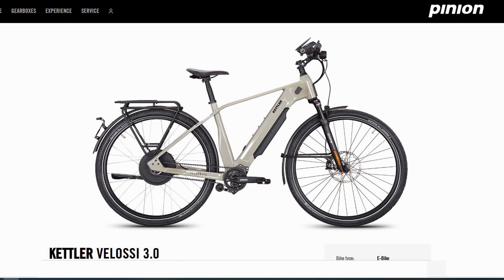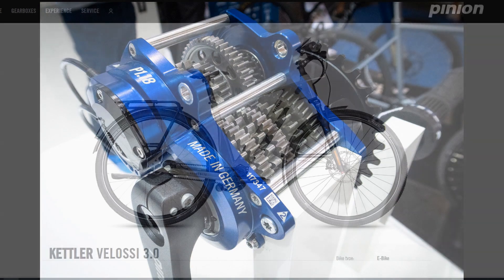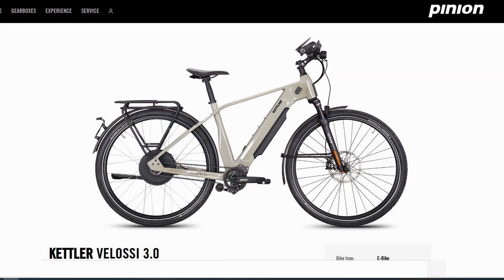There's another fantastic technology — another kind of internally-geared system for e-bikes. It's an enclosed gearbox in the bicycle's pedal crankset. The company that makes it is called Pinion, in Germany. Like the internally-geared hub, the crankset transmission can have as many as 18 gears and is also user-friendly. The iteration shown here uses a hub motor, with the advantage that only the force of the rider is applied to the carbon belt, thus providing very little wear. Of all the systems covered so far, this is probably the most reliable combination you can find.